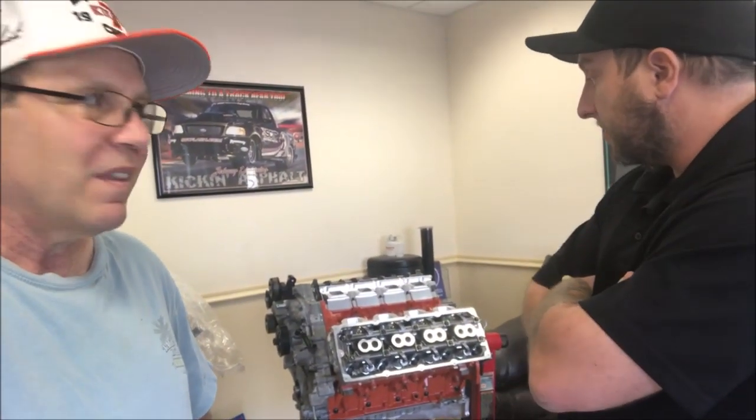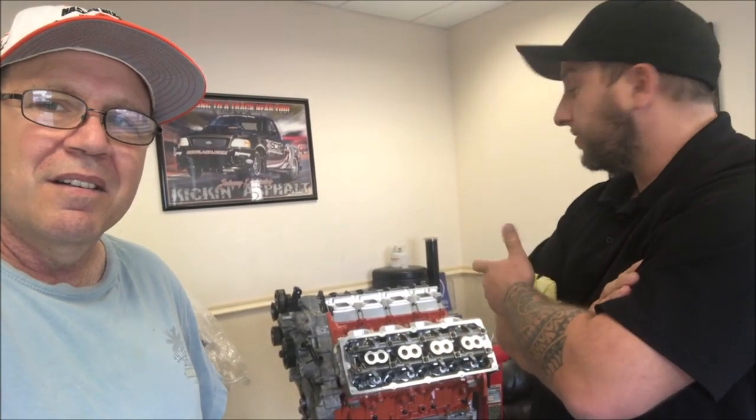So now I have the opportunity to ask you, Joe, tell us a little bit about this motor. Well, actually, High Horse Performance got us this 426 short block with the Thitek heads. We're doing a custom cam in it. It's obviously got the Whipple going on it. We just had the Whipple get serviced by Whipple because when the motor grenaded itself on the stock motor, it sent some metal through it. So that just got back today. Just finished assembling it so we can plop it in there and get her going.